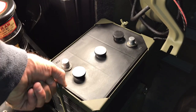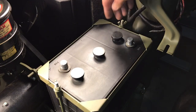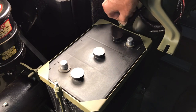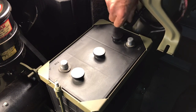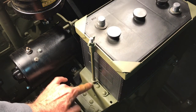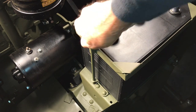At this point I'm not going to completely tighten this wing nut down because I'm going to lift up on the corner of the opposite side and do the same thing with the J bolt. Lift up on the corner, install the J bolt, install the washer, the lock washer, and then the wing nut. Then I'll snug both wing nuts up. I'm going to make sure the J is cammed in by turning the top lever — you can hear it click on the bottom — then fully tighten the wing nut so the J is cammed into the backside of the battery tray.